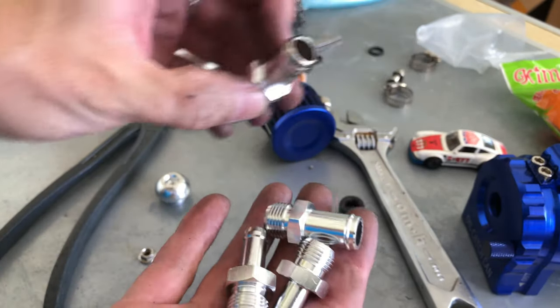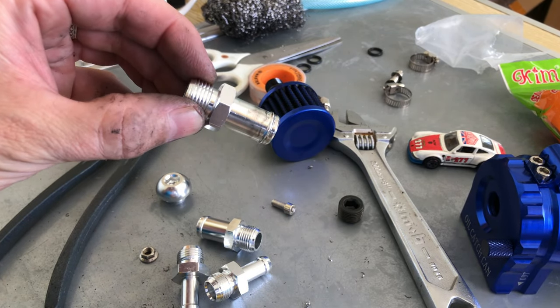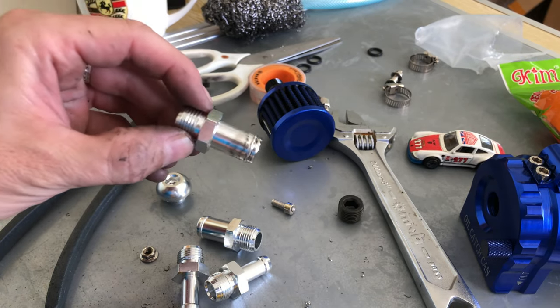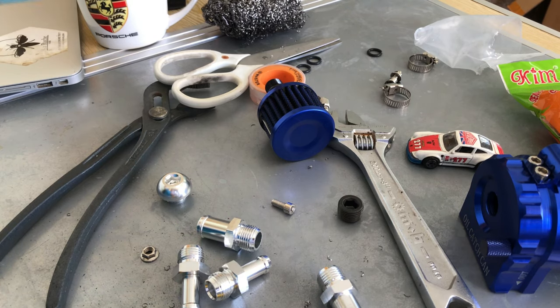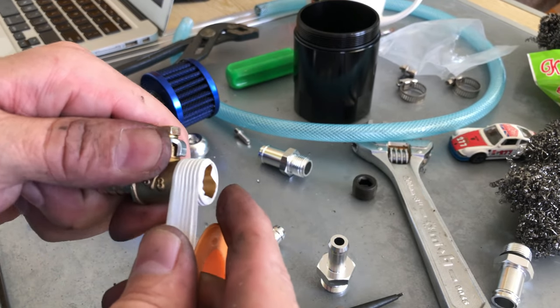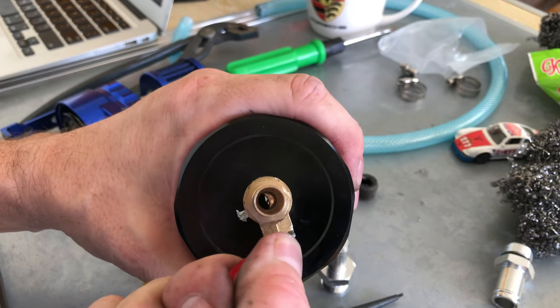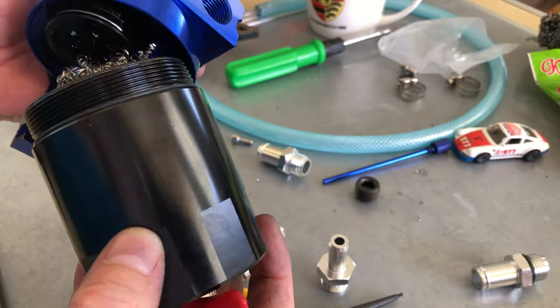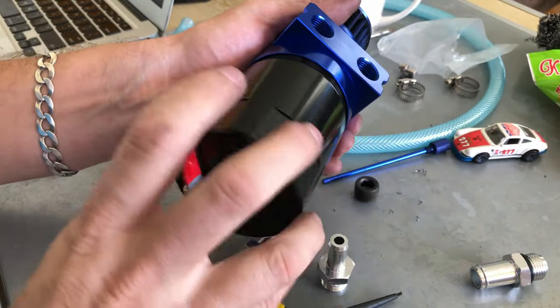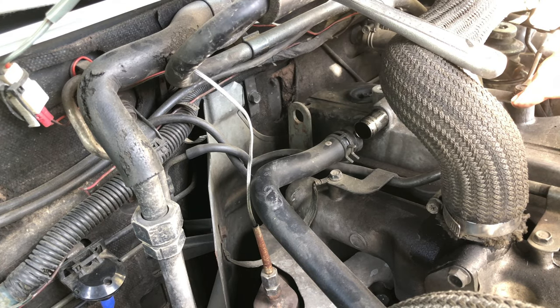On the inside of the bracket there's a pretty good selection of tube endings. This one fits perfectly into the tube that goes between the air cleaner and the turbo intake, so that's cool. And then this hose they provided — this will give me a chance to watch what's going on with the system. From the valve cover, the gases come up, collect in the valve cover, go out there, down here, and into your turbo intake tube.